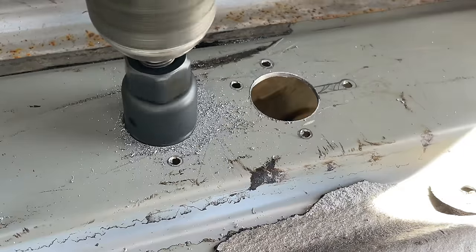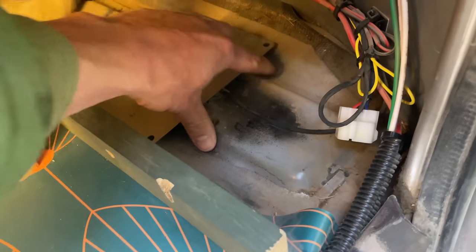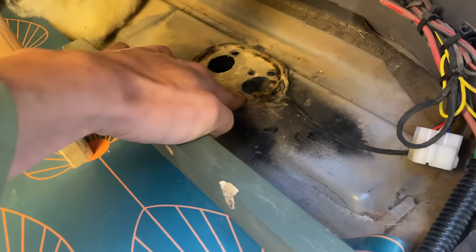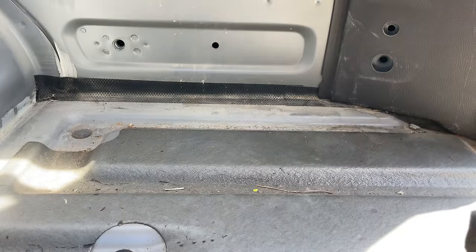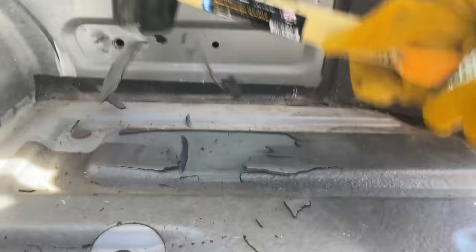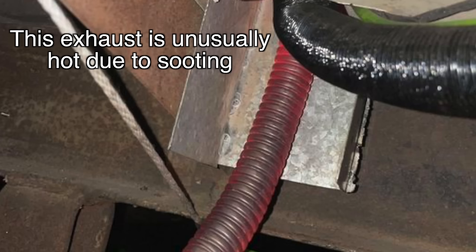This mounting plate wouldn't have worked because the way you're supposed to screw it down kind of didn't line up with these ridges, and one reason why you might not want to do this is because there's often sound deadening material in cars, and so I had to remove that sound deadening material. And then paint is technically flammable. So the real danger is that the exhaust gets really hot, and so anything that's even close to the exhaust has potential to catch on fire.